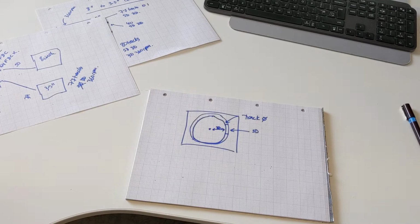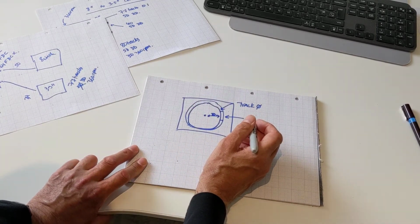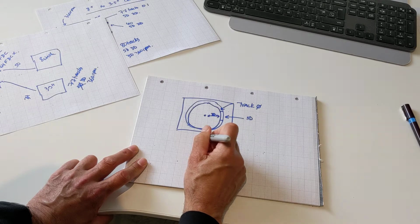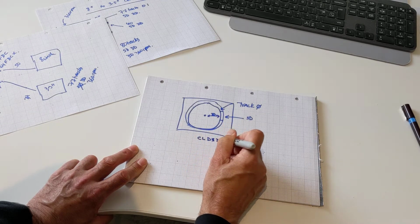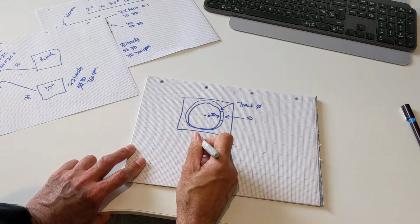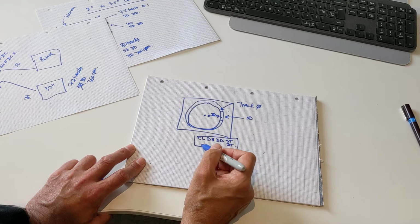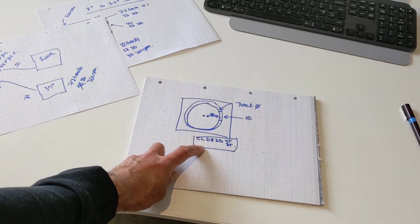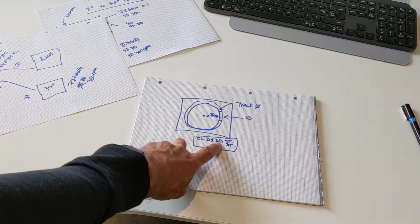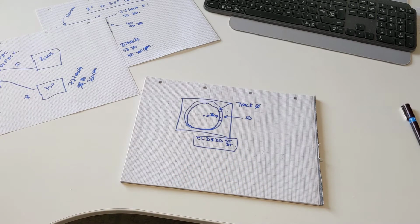So when the user put in a double density disk that was formatted for double density, it would actually read a special label that was on track 0, written at single density, and that label had the provision to be 8 characters long. So it was something like, for example, for Cromemco, CL, DS, DD, and there was a provision for single tracking and double tracking, but that was never implemented. So there was a label that was written on this disk here, I think it was track 0, sector 0, counting from 0. The computer would read this label and it would say, aha, this disk is in fact a Cromemco large disk. It's double-sided, double density, and this was never implemented. So it would know what kind of diskette it was.